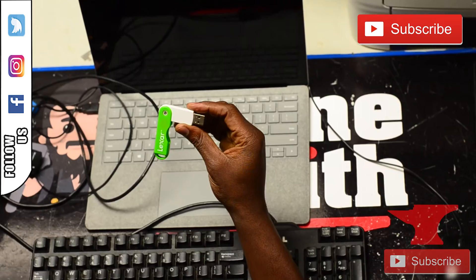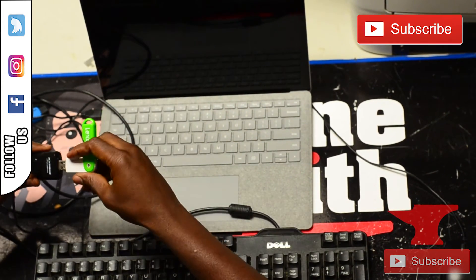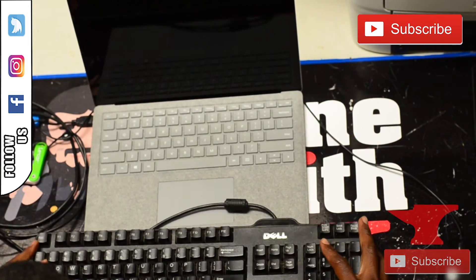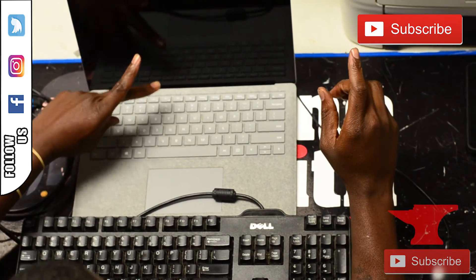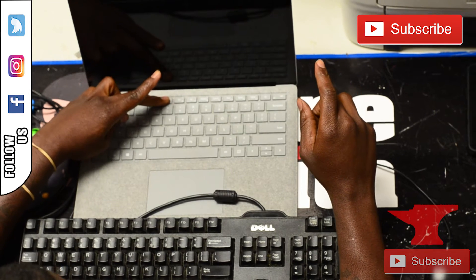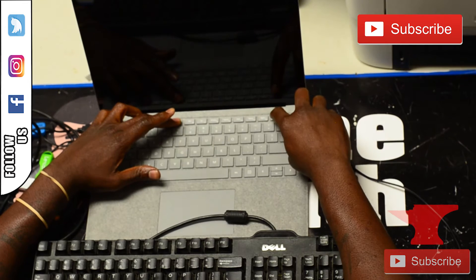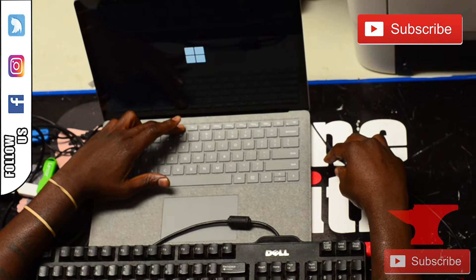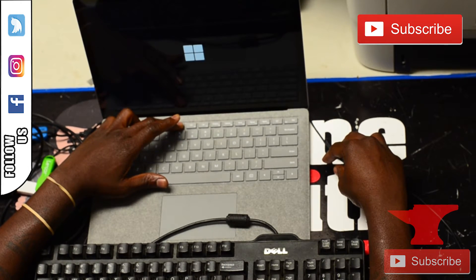This is Windows 10 on the flash drive — plug that in also. Now in order to boot from your flash drive, you would have to first hold the volume down button, then hit the power button, and hold it down until you see the startup page of Windows 10.